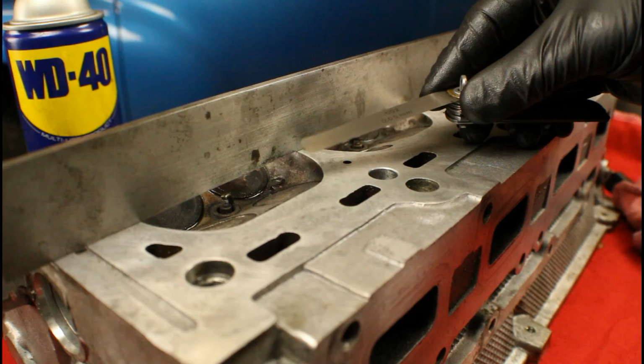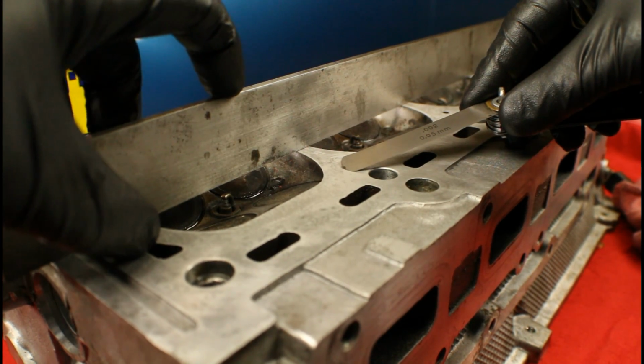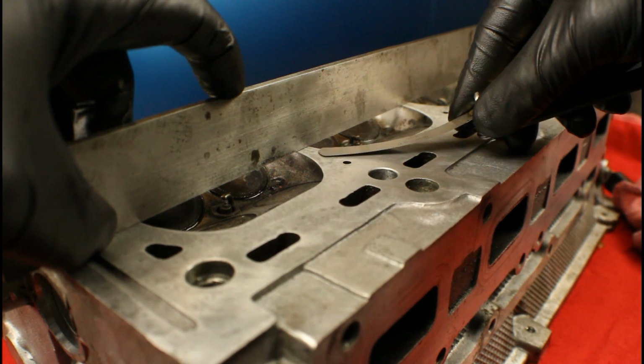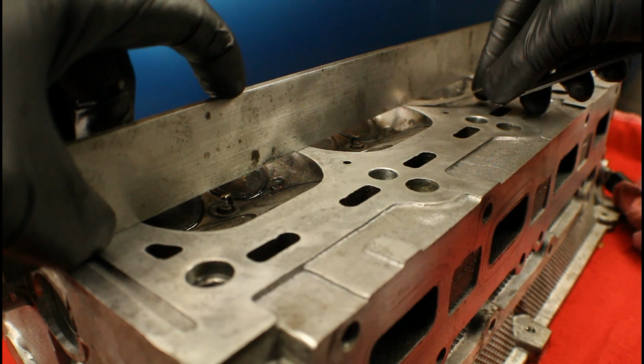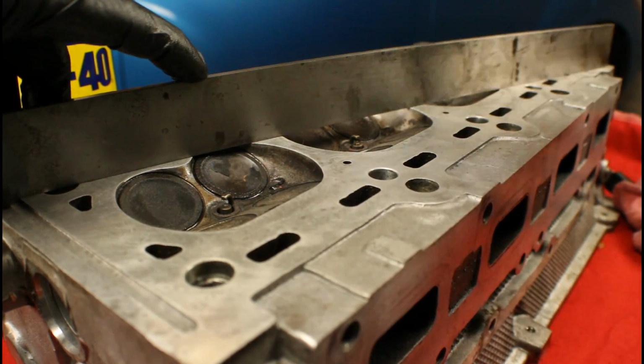So I'm going to start with a lower size feeler gauge. In this case we're going 0.002, that's 0.002. I'm going to press down on the tool and support it so it doesn't fall over. Grab that feeler gauge and see if it easily slides up under, and it does. So we can go on down the length and check that. Once again, we'll do it at an angle.